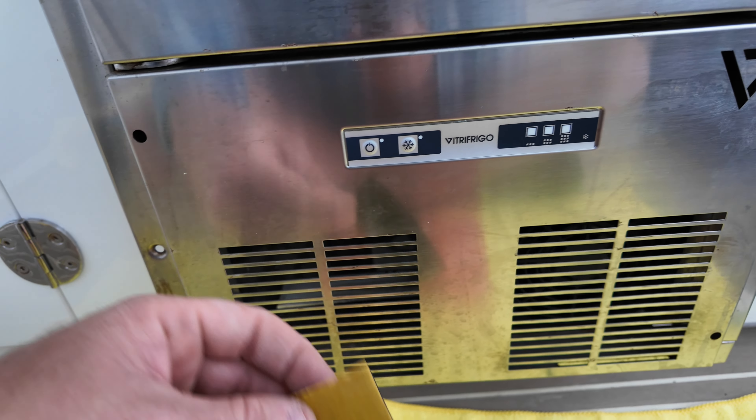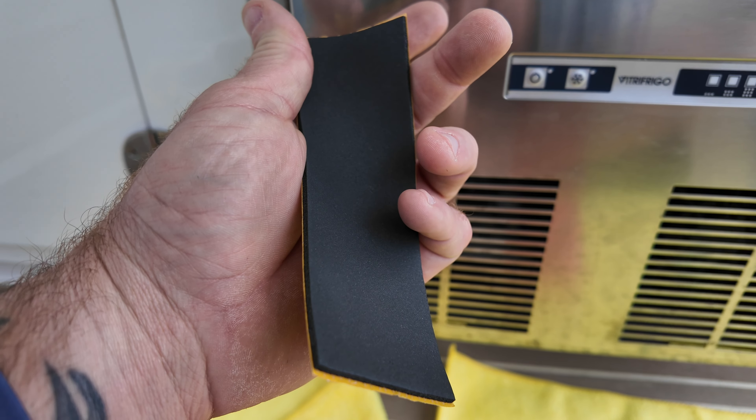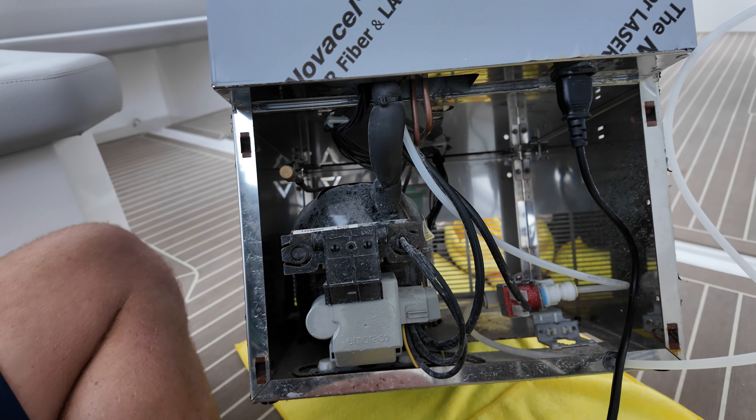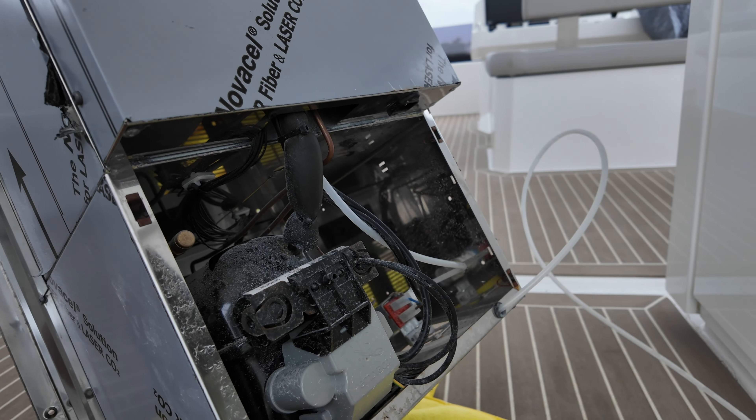This one didn't have it from the factory. I guess they're aware now of the problem. The back didn't have the sticker before. So we'll go ahead and put that on and get it plugged in. That's what it looks like with the foam piece inserted, so it doesn't get water from the back and create the corrosion. She's all plugged in. We're going to put our protective snapping grate back.